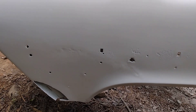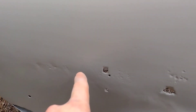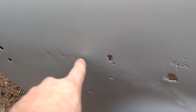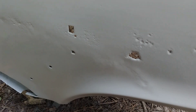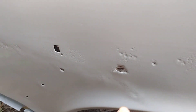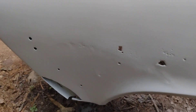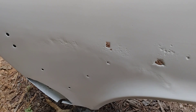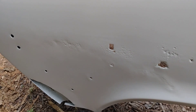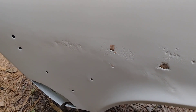I've been working on this fender here trying to get this mess straightened out. I almost got it — still a little bit high right in this area. I'm going to have to hammer and dolly that out just a little bit more, but I got all this straightened out fairly decent, and this area down here too. I'm trying not to put a lot of heat in this fender welding-wise because I don't want to warp it — otherwise it's gonna have a bunch of waves in it like the ocean.